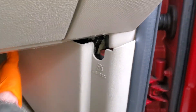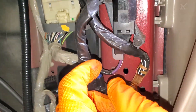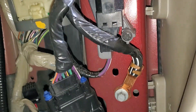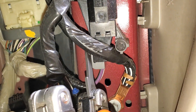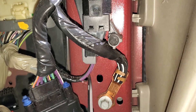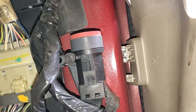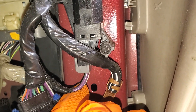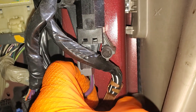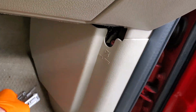These do fail though, so you can test them. You can see there are two wires going into it. When the fuel pump relay is engaged, it energizes the violet-green wire. If the switch is working properly and hasn't been triggered, it takes the power from the violet-green wire and passes it to the green-white wire. That green-white wire doesn't go directly to the fuel pump — it instead goes to your fuel pump control module.